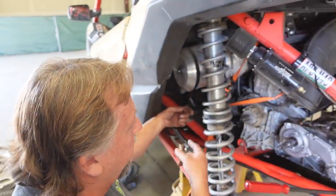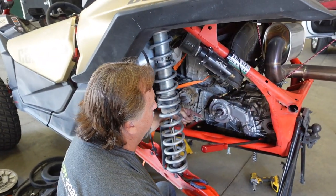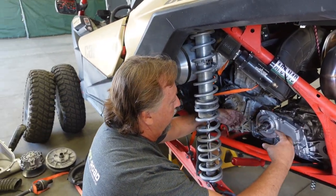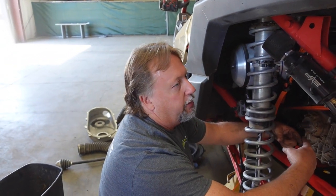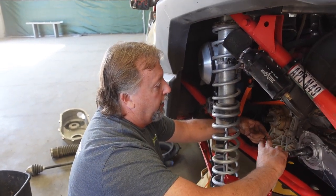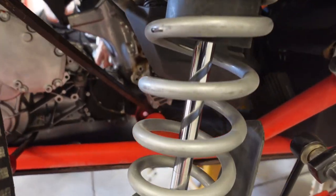So you get your front drive line. It's basically a through shaft coming through the motor right here. Yep. And it goes into the transmission. Yep. So when you mesh the transmission up to the motor, there's a seal there, and basically you're stabbing it in. It's like a slip joint, I guess. Yep. And we got these snug, and we didn't have to fight them, but you could get it started and get it off, and you're jamming the teeth instead of going in. Yeah, it went in pretty easily, so I don't think we did.